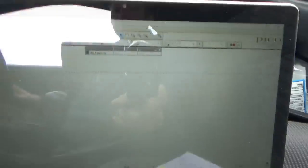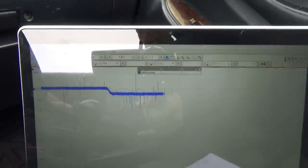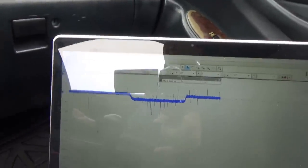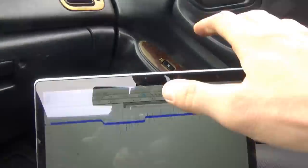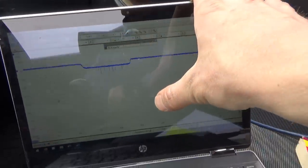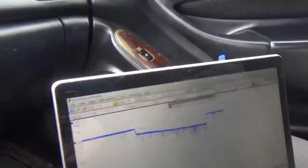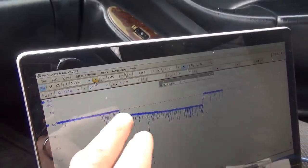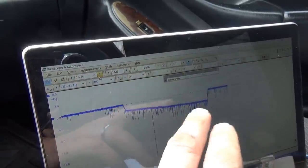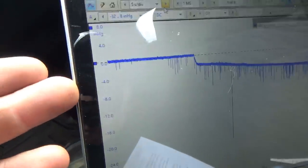You can already see some activity on the EGR valve actuator. Let me give it a little throttle. There you go — that's pretty neat. So the system's working. And I want to see that under medium throttle, if that vacuum is excessive, it means we're getting too much EGR flow. So we've got a capture — kind of medium throttle, acceleration up to 3,000 RPM — and you can see the vacuum supplied to the EGR valve is slowly increasing, only to 4 inches of mercury.